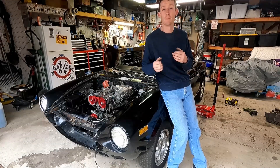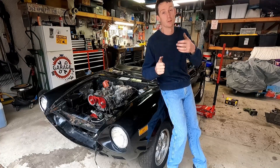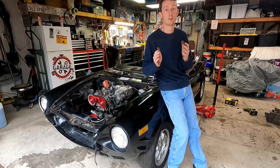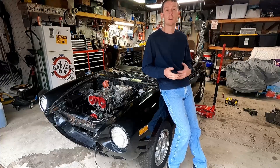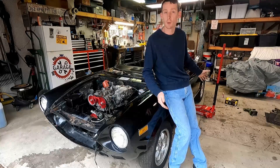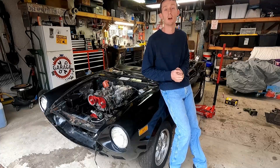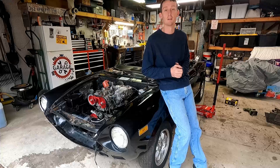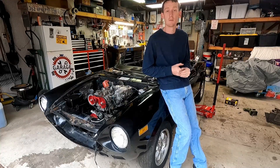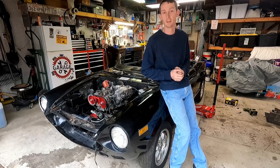And that's all there is to it. In a matter of minutes you can go from the old school lug bolt pattern to modern studs with lug nuts — it's so much easier to deal with when taking your wheel off and on for future maintenance. You do want to make sure you torque all the wheels down to spec in that star pattern to bring them down evenly and completely. Thank you so much for watching — make sure you like, comment, and subscribe, and until next time, we'll see ya.